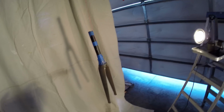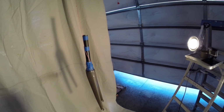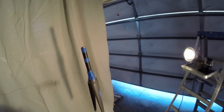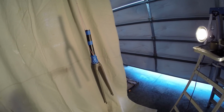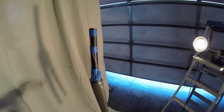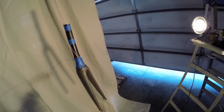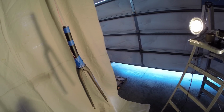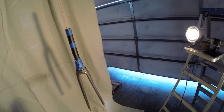It does look very glossy and shiny and sparkly right now, but keep in mind the Plastidip is going to dry as more of a matte finish. So you're not going to get the super glossy effect unless you're using some of the glossy Plastidips. As the Plastidip starts to dry, it'll be very obvious: the gloss and the liquid nature of it dry up, and you start to see a dry finish. You can see that the light shining off it isn't quite as bright as it was. So it'll be very obvious when your next coat should go on.